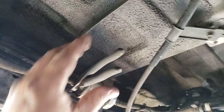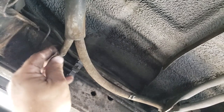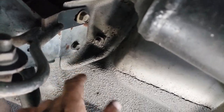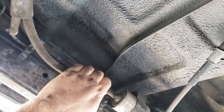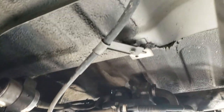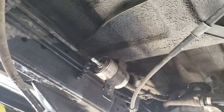Safety goggles under here. I've moved the clamp over. I'm going to take it off here also on the vent line, move it over, and take these off — I've disconnected them at that factory-looking bracket. I'm going to see if there's a different way to route them, then it comes back to this bracket. But this can still be under residual pressure, so when you pop this off make sure you have your safety glasses on. See? We've got fuel pumping out — it's just residual. Just be careful — you don't want to get yourself eyeballed up.